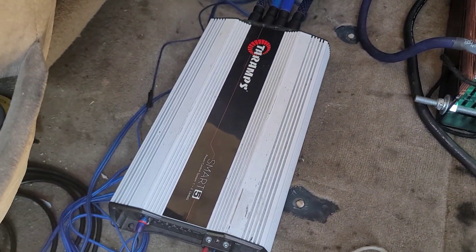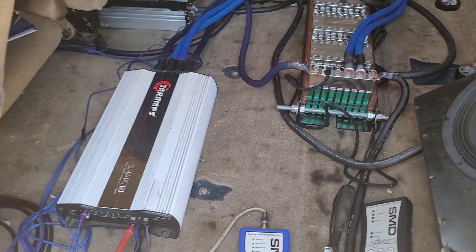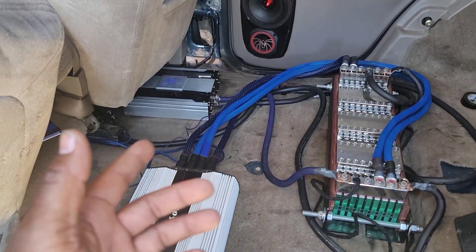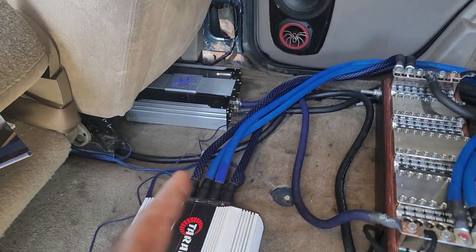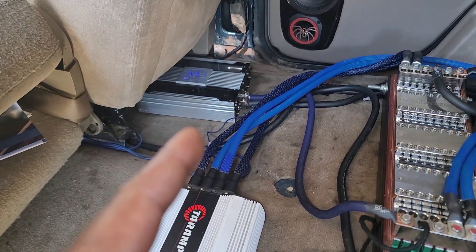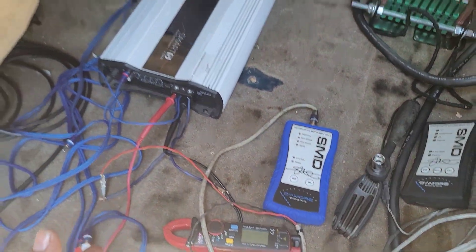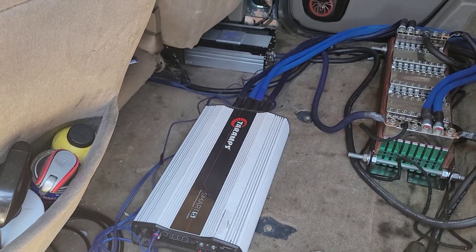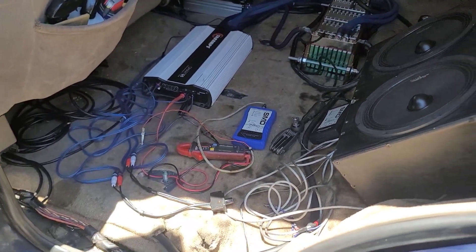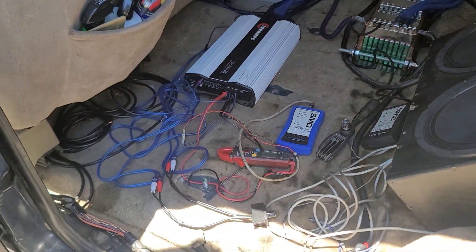What's interesting about the Smart 5 is it does rated power at both 1 ohm and 2 ohms, and my system rises to around 2 to 2.5 ohms, so I should be getting more power than I tested from that amp at 1 ohm. That said, even though the Soundstream TXP says 18,000 watts, for around $350 I was able to get 89 to 90 volts of output clean. This Smart 5 is only doing about 83 volts and costs about $450 — an extra hundred dollars or more. Stay tuned for the next video where we'll see what that 83.5 volts equates to on the SPL meter. Peace and love, thanks for watching.